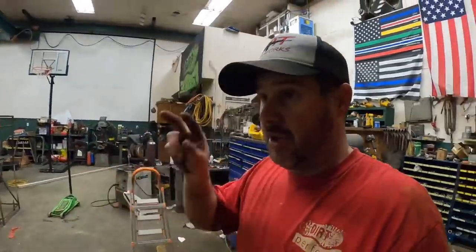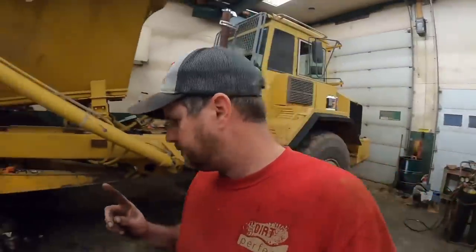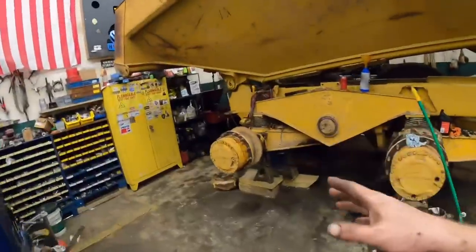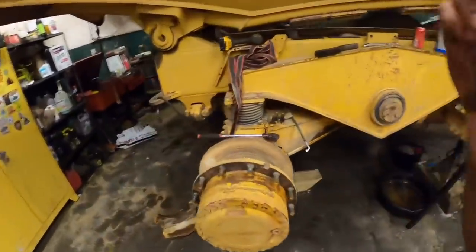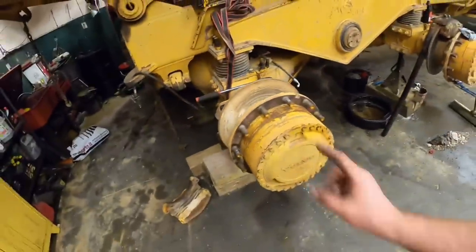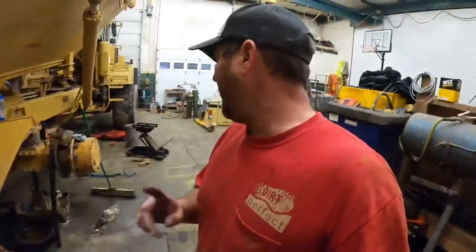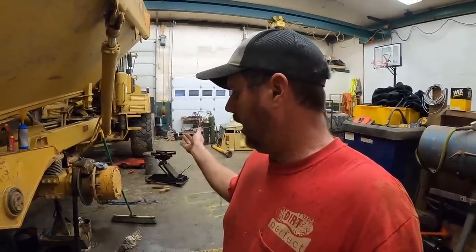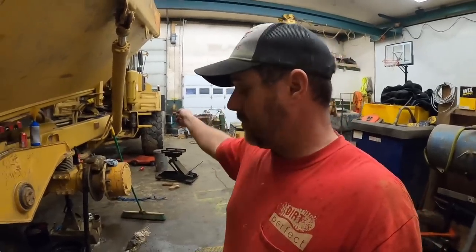That one's not too bad. The front two axle seals are really bad. I thought I was going to run it for a while, but they are — you're probably seeing in some of those shots when we pulled the lockers apart — they're puking oil pretty bad. So this is my thought: I don't quite want to jack the front end up to take that tire off because we've got the whole back end off the ground. I can't put these tires back on until I get my brake components. So for experimental purposes, let's go ahead and yank the axle seal out of this one. From what I can tell from the parts book, all three of these axles are the exact same, so whatever we do here should be the same process.